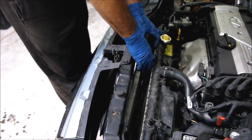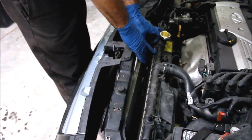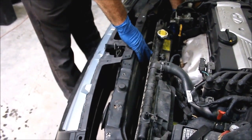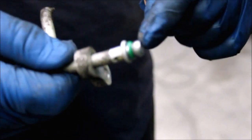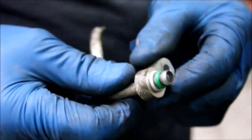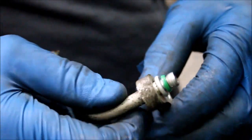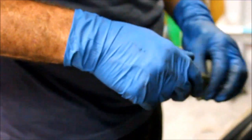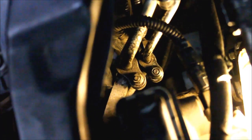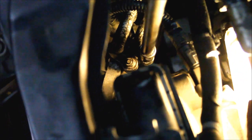I just need to put in each of the two bolts and reattach the two lines. Before you reattach the lines, inspect the O-ring. The connectors have a green O-ring — as long as what you're putting back is intact, put a little bit of lubrication around it, whether it's some of the oil that's around the area or some Vaseline, so that it doesn't damage the O-ring when you push it back in. Then tighten the nut back up. I inspected the green O-rings on each of the pipes — they were fine. Put a little lubrication on them, slid them back into place, and now I'm just tightening the nuts. Doesn't take much.